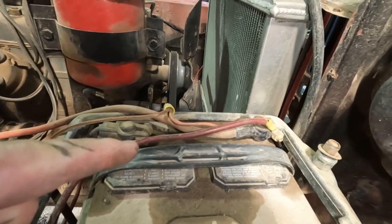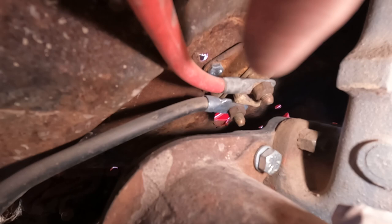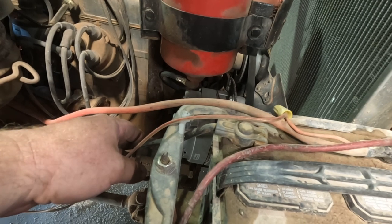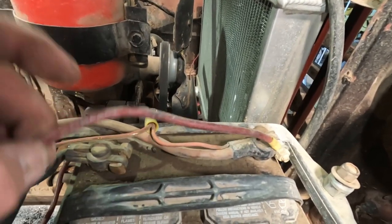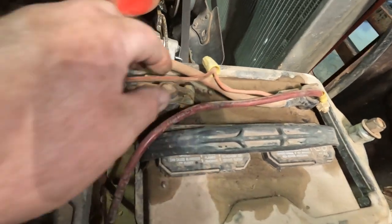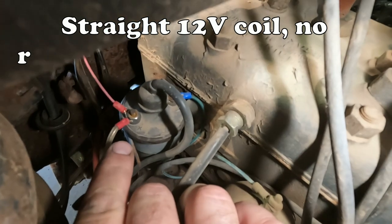Here's all you need to actually run one of these Jeeps. Obviously you need a big positive and a big negative from the battery. This one goes to the starter switch. These Jeeps have an inline starter switch right on the positive cable, so no solenoid wire needed at all — it's pure mechanical. The negative goes right to the block. Then I have an ignition output and this is the alternator in. Since I have a one-wire alternator, that alternator in goes straight from the alternator right to the battery. The ignition wire goes straight from the ignition — I actually have it run into the interior to a switch and comes right back to the positive terminal of the coil.